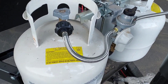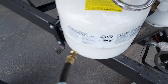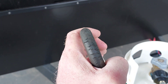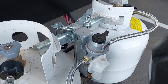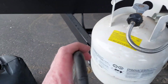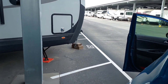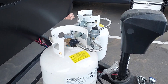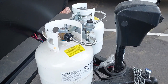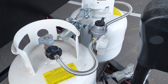Since we're here we went ahead and changed out the propane lines. I bought these stainless covered lines, hopefully that'll make them last longer. Here's my old one and you can see the cracks in it. I kept the other one - it was still good, I'll save that as a backup. I tested it out and I don't smell anything, and my nose is pretty sensitive to propane. I was surprised this only lasted - this RV is not even three years old and I'm in covered storage. I had another toy hauler where the front sat in the sun almost all the time and it lasted five or six years before I had to change the hose.